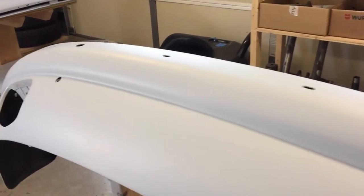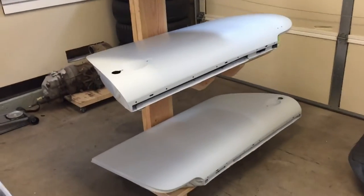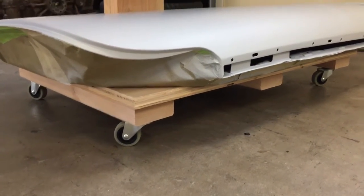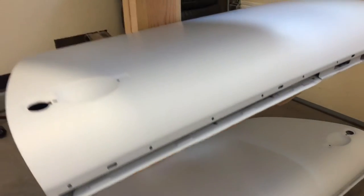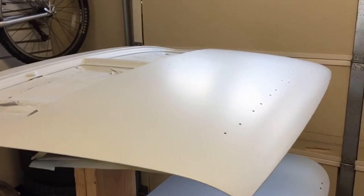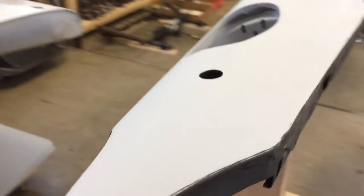I also made a three-stage movable dolly with casters — this one's a little heavy with the two doors and the trunk lid, so I put wheels on it to move it around. There's plenty of space between the pieces so they don't accidentally bump each other. I've got the last coat of K-36 on these, and for the fenders I've got some horses and side props. This little side prop keeps the fender kicked out so it doesn't roll around while I'm sanding and painting.